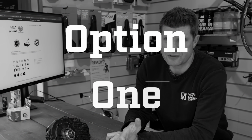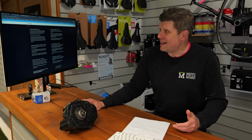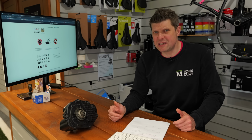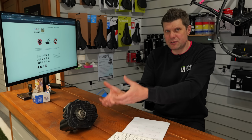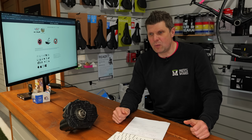The first one, we can attempt a repair. The big thing with this really though is that PCB, and that goes beyond what most bike shops and mechanics can do. I've reached out to a couple of PCB repair places and they weren't willing to give me an accurate quote without sending the motor away to them. And we do need to do that, as you saw on that teardown, that PCB is attached to that motor, which is then glued into the casing. So we're going to incur some costs by sending it away.